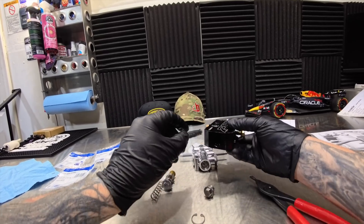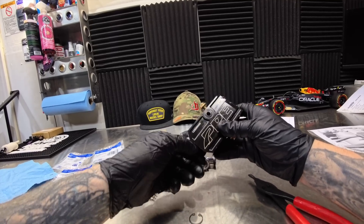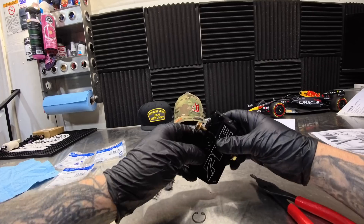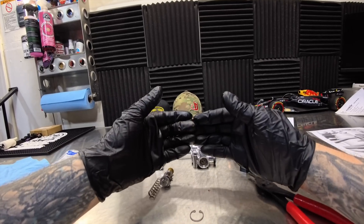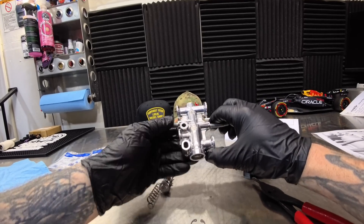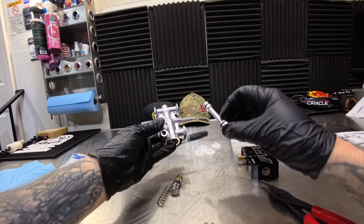The issue I had was when it came to winter time, the max temperature I saw was 120 degrees. Research has shown that too-cold transmission fluid has much less side effect than too-hot fluid, but still, too cold has me concerned — because condensation can build up in the transmission fluid itself and that's really bad. So that's why you want higher transmission temperatures than 120 degrees, at least if you're in freezing conditions — and this is my opinion based off my experience.